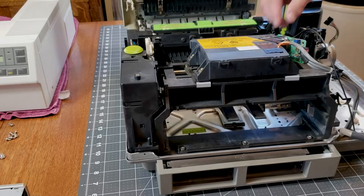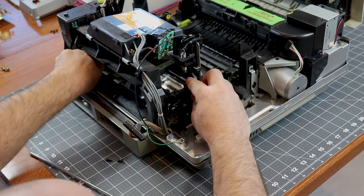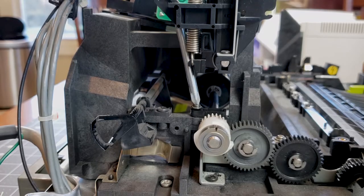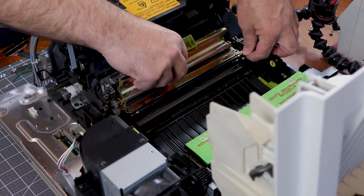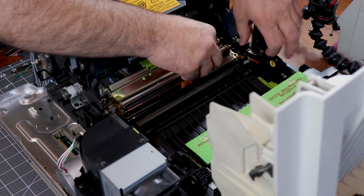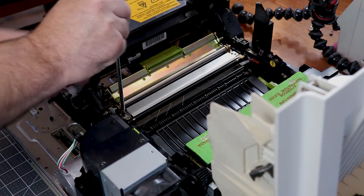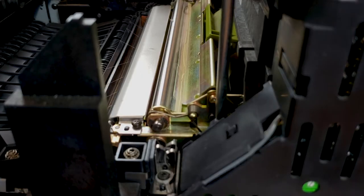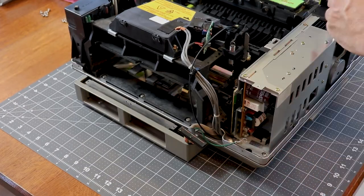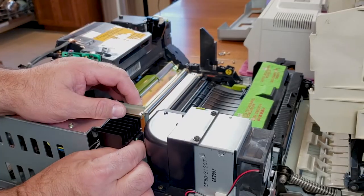Now I remove the painter's tape and start reassembly. The feed roller assembly is installed from the right side — it's important to make sure the small brackets are properly seated before installing the two long screws. To reinstall the registration assembly, drop the cork pad in under the feed roller then seat the assembly, making sure the bronze grounding block is properly seated on the corona grounding spring. Don't forget the paper guide plate, then install the four screws. To install the DC controller, seat the connectors on the bottom then install the three screws, making sure one has a star washer for proper grounding. Then plug in the main motor and you're good to go.